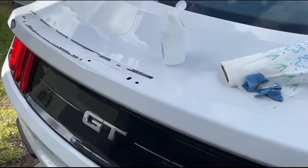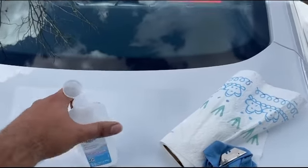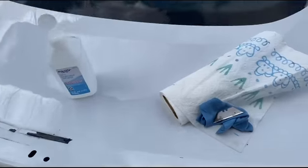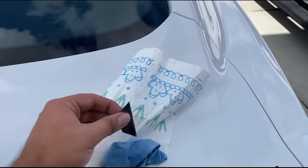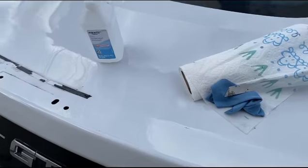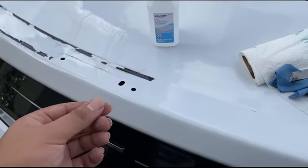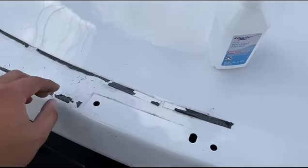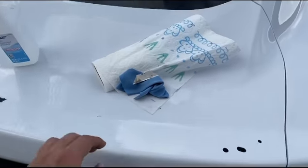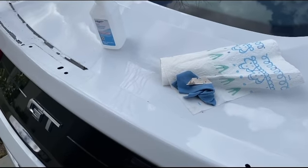All right, so we're cleaning all this gunk off the trunk, and I just wanted to show you guys how exactly I am doing that. There's nothing better than isopropanol. Look at that. Rubbing alcohol, 70%. Good for infections, good for a new spoiler. Make sure to use some type of sharp knife. I know this one on the edge is oxidized, but it's actually pretty sharp. You want to go easy with it. All you really want to do is try to peel it off. This actually comes off. Pour as much rubbing alcohol as possible. The rubbing alcohol breaks the adhesive properties off of this gunk. So go easy, go slow. As you guys can see, I'm going really slow. I don't want to damage the paint of the car or anything. Still a little bit of gunk that I need to clean up. This is all going to be really sharp and nice and dry. We're going to put in a new spoiler soon, okay?